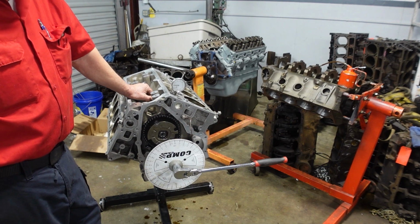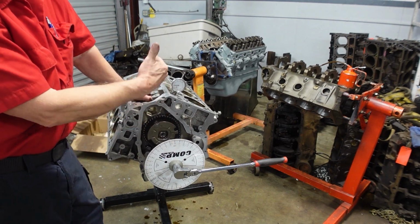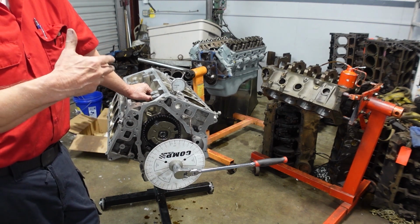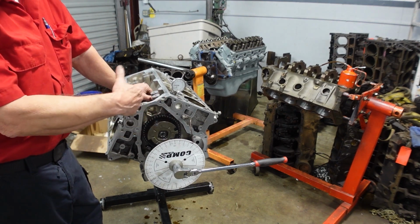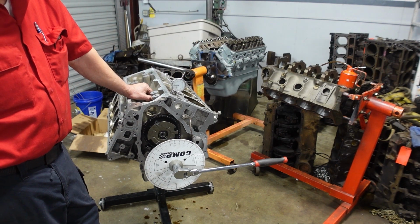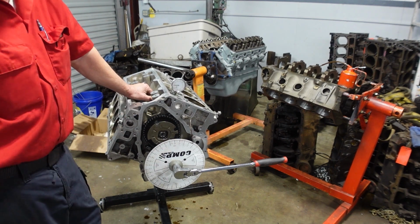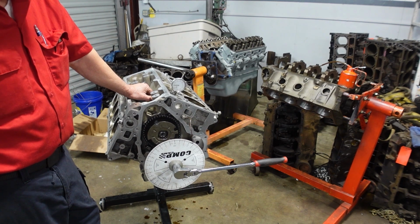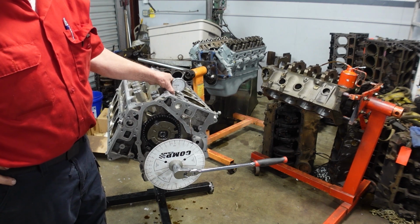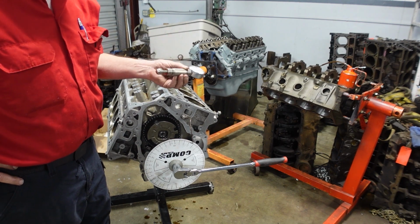Now, you can order a cam with 4 degrees advance in it, and you would put it in technically straight up and down, dot to dot, but the cam would truly be 4 advance. If it wasn't ground that way, I would use a 4 degree bushing or change it where it was. I'm assuming it's in there exactly where they anticipated it. That's where the development was. So we think it's where it belongs. Educated guess, absolutely. Best educated guess we can make.